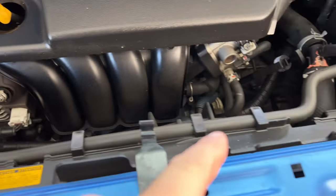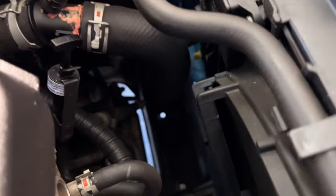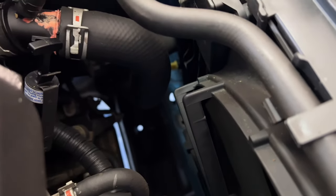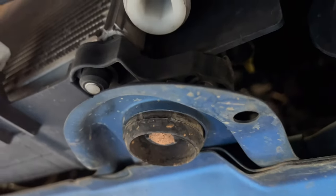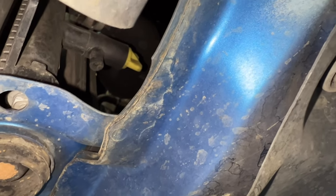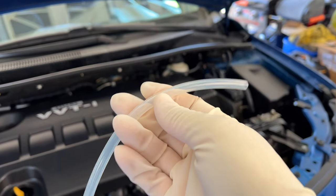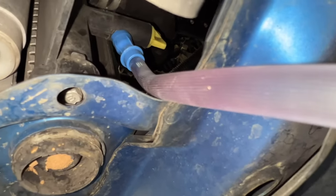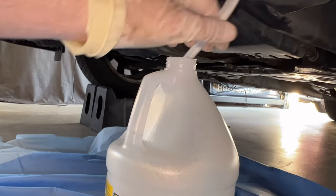The first thing we need to do is get the old radiator fluid out. Make sure your vehicle is lukewarm or cold when doing this. There's the little drain valve right down there — it's either going to be orange or yellow like this one. Hook up a tube from underneath the vehicle; I actually had to get one a little bigger and put it onto the bottom of the valve so I can just put it into the gallon jug, making draining a lot easier and helping avoid a mess.